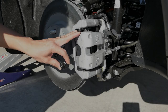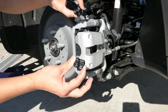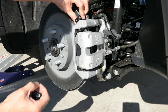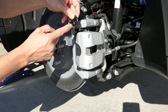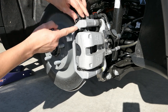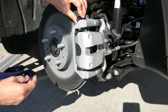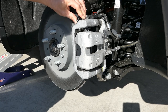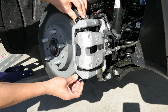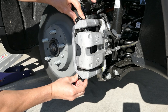We're back at the rear caliper. I'm going to show you how to use these little braces to properly align the caliper cover. L4 goes right up here — you can see there's a little indentation that matches to the caliper and it sits snug. If you try L5 there, it does not go and you can see the movement. So L4 goes up here and L5 sits down here, and you can see how nice and tight it is against the caliper.